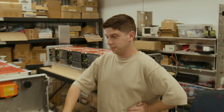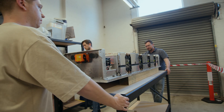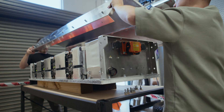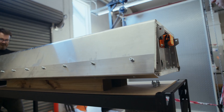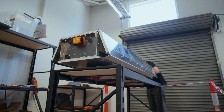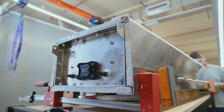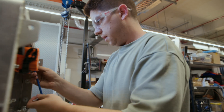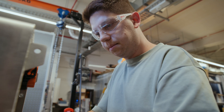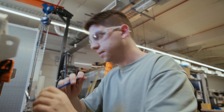We'll go from a series of modules to modules in series — and the battery. These sub-packs are ready to go on. You've joined us putting the battery top cover on. It's a folded honeycomb, folded down the two sides there, that meets up with the two end plates with a hell of a lot of M8 fasteners. We're just working on closing that up now. This is essentially the last part of this battery mechanically — electrically it's complete. Then we'll move on to testing and put it in the back of the car.